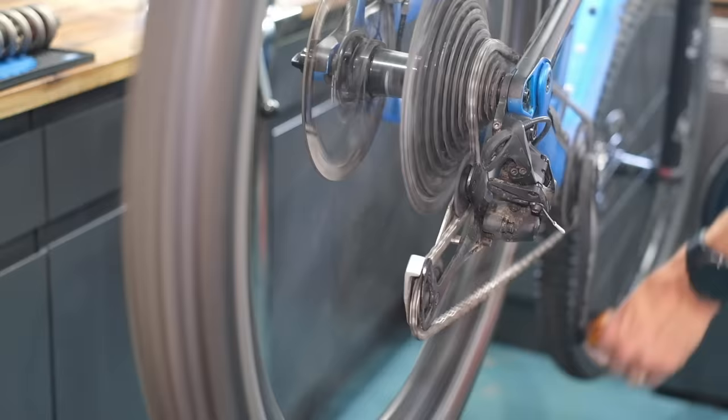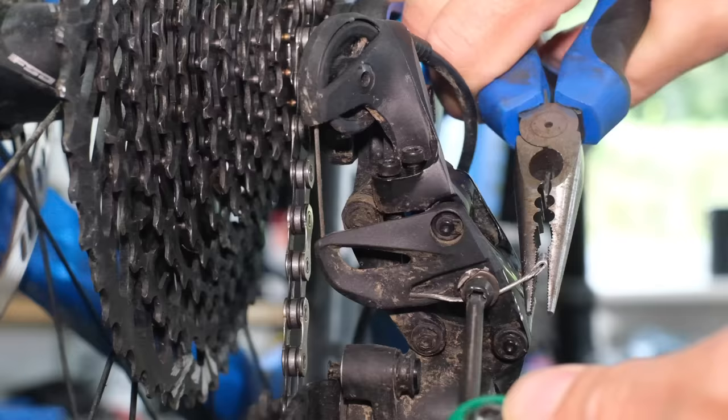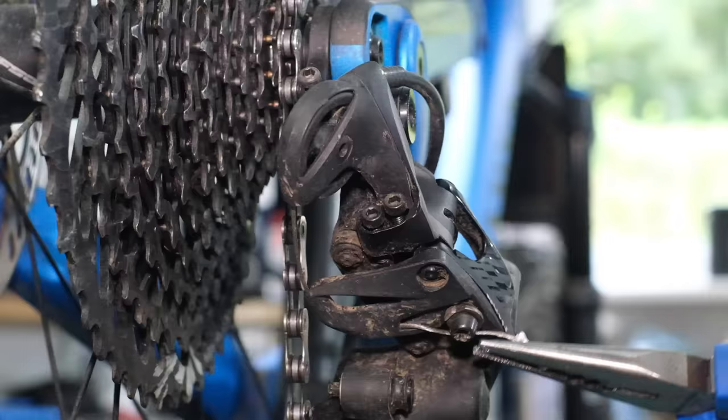Be careful where you put your hands. You'll be able to see if the chain naturally drops back down when you release your hand — the derailleur should allow the chain to pop back down onto that smaller sprocket. If that's good, now's the time to put cable tension back on. When pulling the inner cable through the system, you don't want to pull it tight because the derailleurs have such a small amount of cable pull to actuate them. You want to pull the cable until it's taut. I recommend using needle-nose pliers because they make it easy to grip and are really precise.